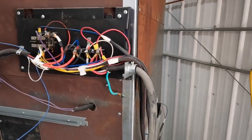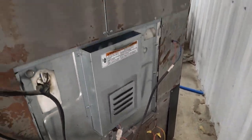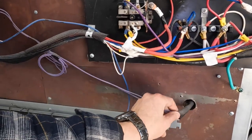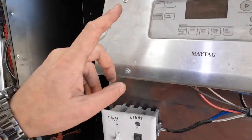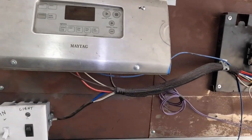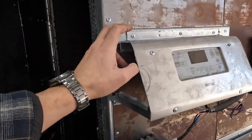Other parts of this that we pillaged, as you've seen in the other videos: we reused the convection fan at the back of the oven, the light, and also the thermocouple down there, which is basically the kill switch when this thing goes thermonuclear, the actual thermostat or element there. For the fan, we took the functionality out of the brains of this thing, because this used to cycle full on, full off, based on just taking power from one leg there. The light was the same, light and fan. From the brains here, we just relocated it because the switch was up on the case and it got removed.